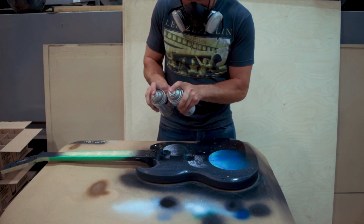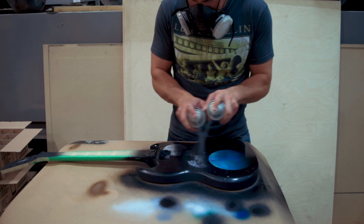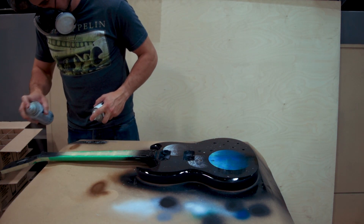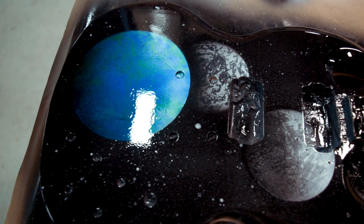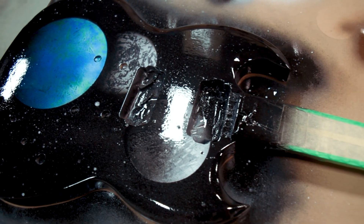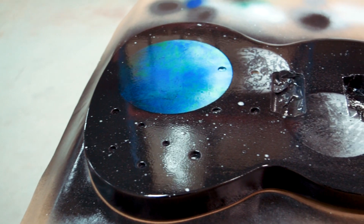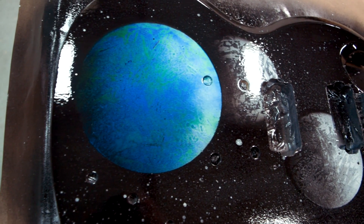You can see I'm using two cans here. This is the technique I demonstrated in my video on how to clear coat better with spray cans — that video is old but it gets the message across. Briefly, the reason is you can put more paint on more quickly, emulating a paint gun better than you could with one paint can. It is a difficult technique that takes practice, but I think you'll find it easier than you imagine.